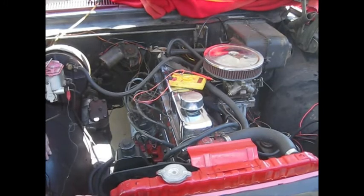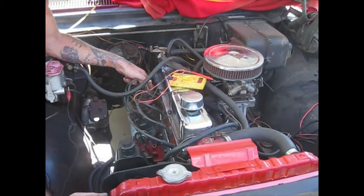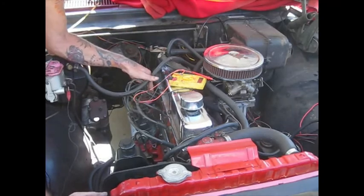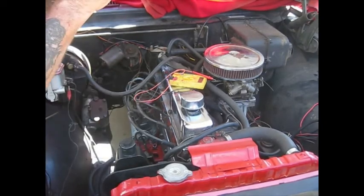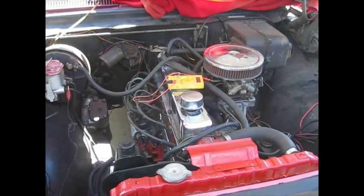A quick talk to the guy on the phone who sells the electronic ignitions — he says I should be having about 8 volts down here. So I need to start checking my firewall plug connections and my spade terminals to see why I'm only getting around 5.6 volts.